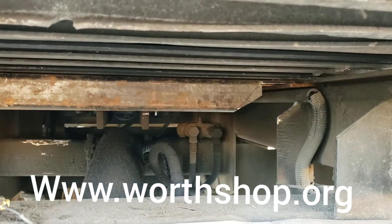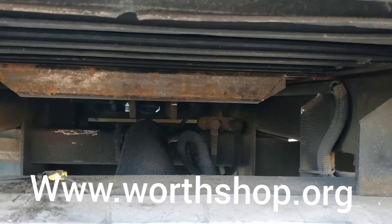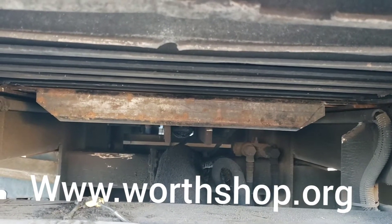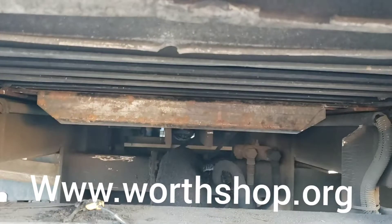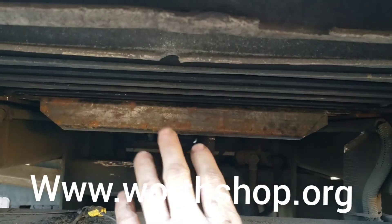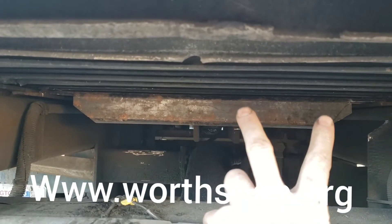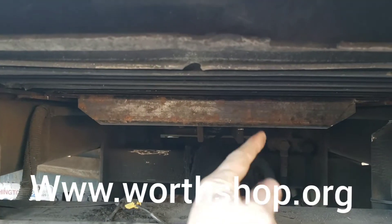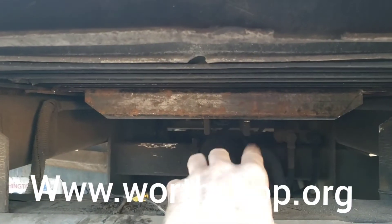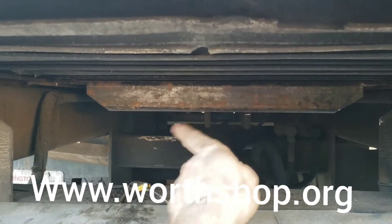I clearanced that — I haven't welded it in yet, but I did run the bed in. Now I'm going to run it back out. I also noticed these are two different lengths — another thing the people who fixed this messed up. So I'm going to have to notch that in order to weld on both sides. I think I'm going to take another piece and make two smaller ones that I can wedge up into each side and weld further up on those two plates, so I'll have one across the back and then one on each side.